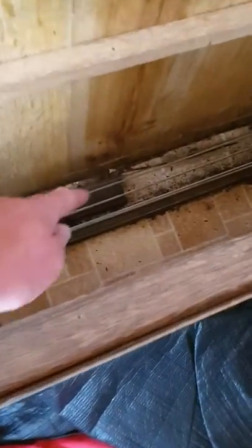I've re-cabled pretty much everything right down inside these tubes. If you can see, the cables go around the pulley into the floor tube, and then there's a lug inside the tube — about that big — with a cable in it that's swaged. It's the lug which then pushes the rod out and pushes up the side walls. I redid the two front ones; the rear ones had already been redone.